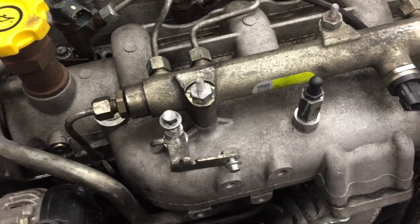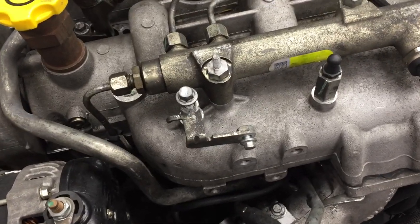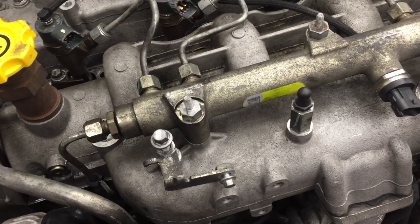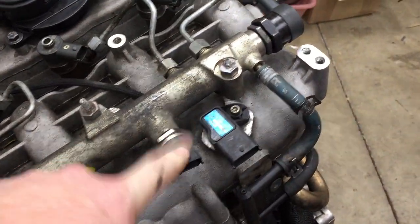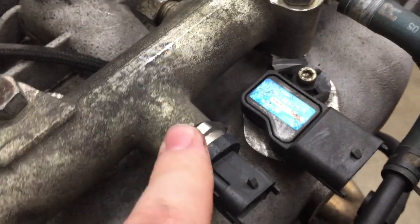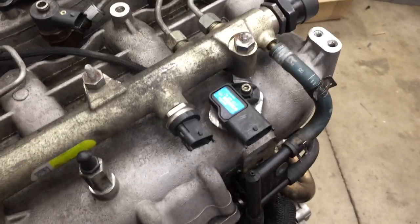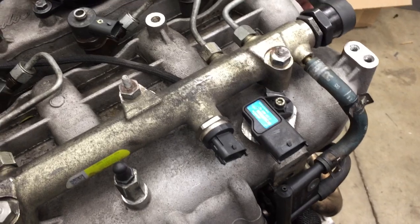The injection pump itself could go bad, although it's a fairly rare failure — I'm not sure I've ever truly heard of somebody who's had one fail. This is the fuel rail pressure sensor, and that can go bad. In fact, this one looks new — I think somebody probably just tried replacing parts in the dark to figure out why the engine wasn't running right. If that sensor goes out and it's not reading fuel rail pressure correctly, you're going to have issues running correctly.